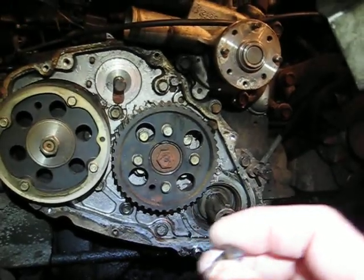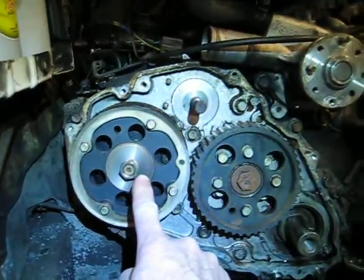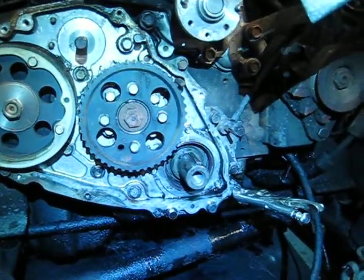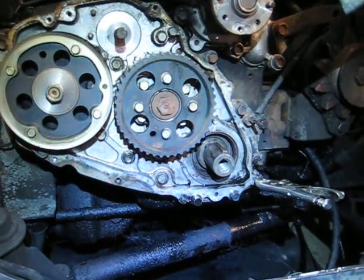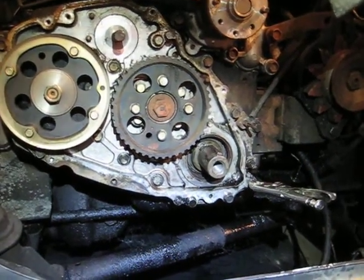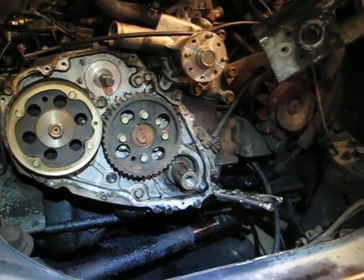The aluminum housing is behind the injection pump pulley, camshaft pulley, and crankshaft pulley — I had the crankshaft pulley off. I'm putting a new front crankshaft seal in there too, and a new seal on the camshaft as well. When I started to drill them out, the little sleeve fell out — they were actually sticking out, which makes it easier. I heated them cherry hot a couple of times, tapped them with a little ball peen hammer, put some Corrosion-X on there, and that one came loose.